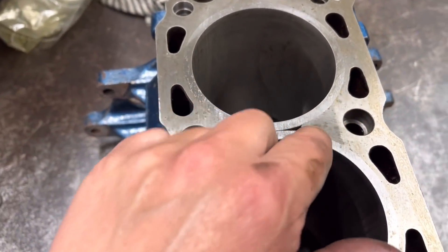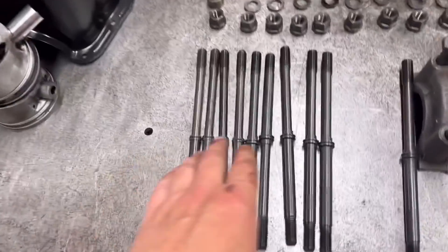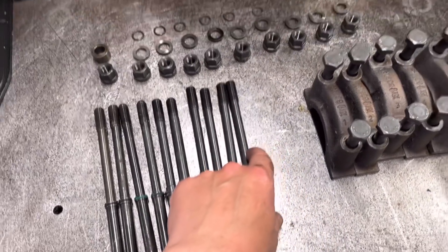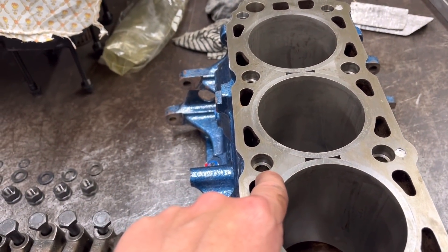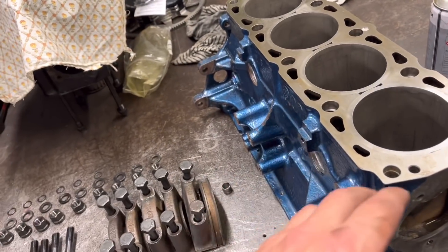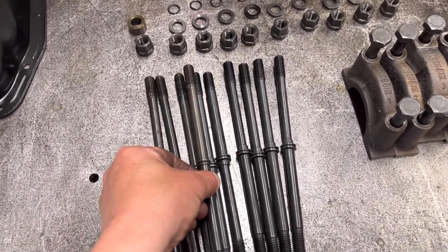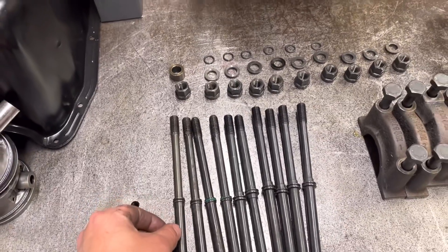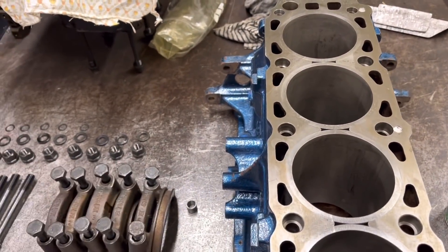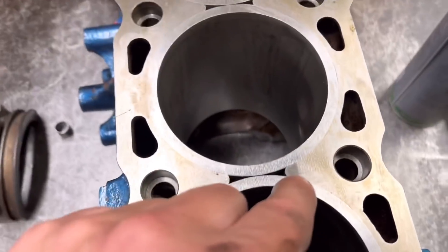Obviously because they're fitted, I'm not sure whether it's an interference fit down the bottom or they use an O-ring. I'm just going to have a chat with Lloyd and say, because I didn't fit them, I'm not really sure how they fitted it. I'm going to have to give it a light lick over — there are a couple of marks on the block face. It doesn't even look clean there before they fitted the liners, and you can feel a bit of a step. We've got a bit of a mix and match of studs — it has been 10-studded. We've got the six with the 17mm seal carrier there, which I don't like using because they never sit deep enough. It looks like what they've done here is bored down deeper so these studs can sit lower. I don't really like that idea, but this seems like a bit of an old school setup. They've used the 14mm seal carrier on the outside, which are fine — they are the ARP ones I get from Julian Godfrey. The block's been machined for it and I'm sure it's going to do the job, providing those centre six do sit down far enough so we're getting a deep enough thread in that lug.